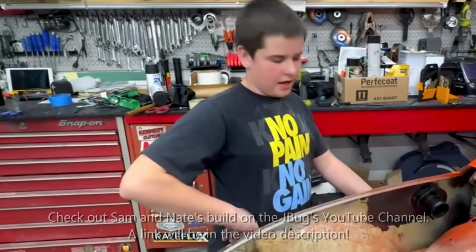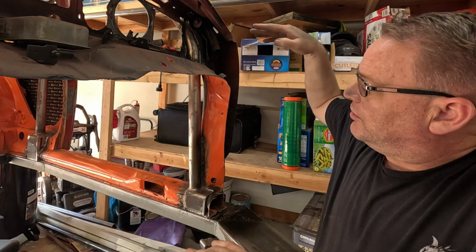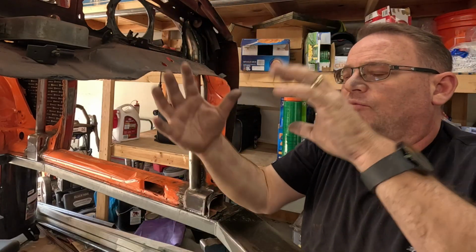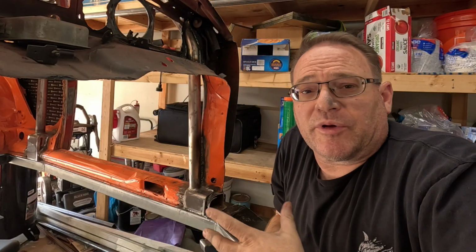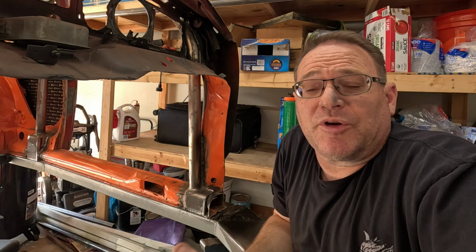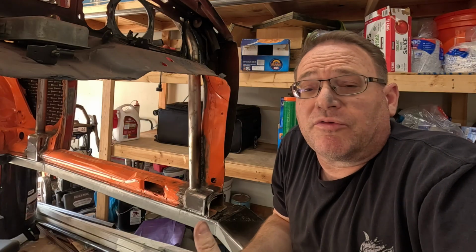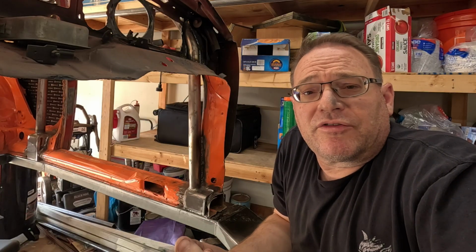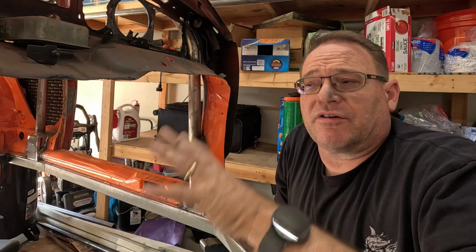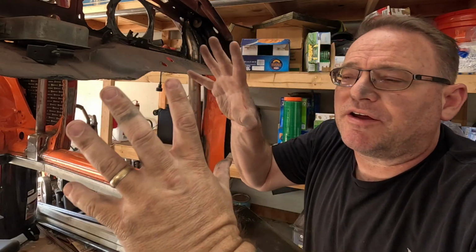You approve? Yeah. Nice. So if I can, I want to put the cage work up here and drop it down to the chassis. And all of this will basically mount where my condenser is for my air conditioning and heating. Going with a Honda V6, that's one of the options you can do. I'm going to go to the junkyard, get myself all the bracketry and stuff of that nature, and hopefully run a factory air conditioner compressor and all that stuff. Just run aftermarket lines and condenser and distribution box. Yeah, I want to copy them and just put it right here.